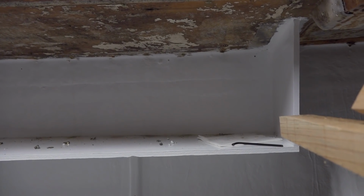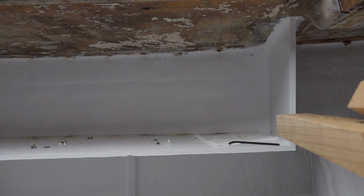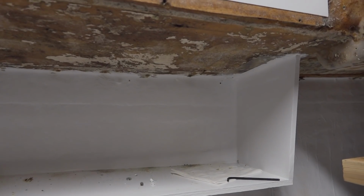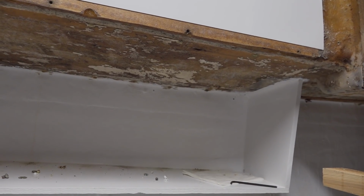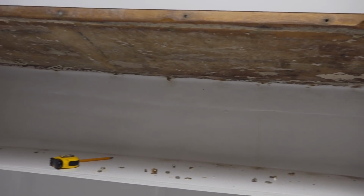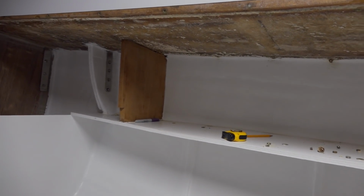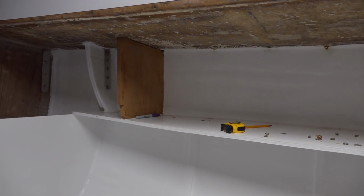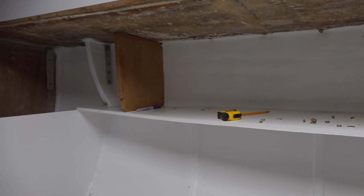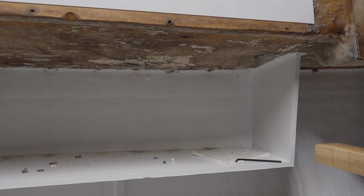If you can see, I'm going to step in that spot where the camera's shooting, up here. So yeah, while these bolts are out of the way, I'm going to put some glass under there and see if I can add some strength back into the deck. I think that's mainly due to the teak decks being removed, and I really should have put down glass on top of the deck, but I've already painted it, so I don't feel like sanding all that back off.